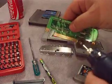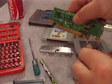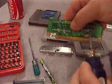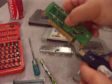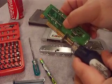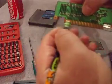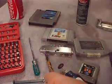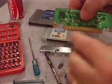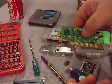Very important when you're using the Dremel: don't force it in there. The steel bristles on this brush, if they do get in there, will break the trace. If that happens, throw it away — you're not going to be able to fix it. Very, very lightly just go across like this, or hit one individually. When you're done, take the pencil with the eraser and give it a little rub to get any loose fibers that may have come off the brush. Don't rub your finger across it, because the oils and dirt from your fingers end up on the terminal. If you've got a toothbrush, use that to get the debris off.